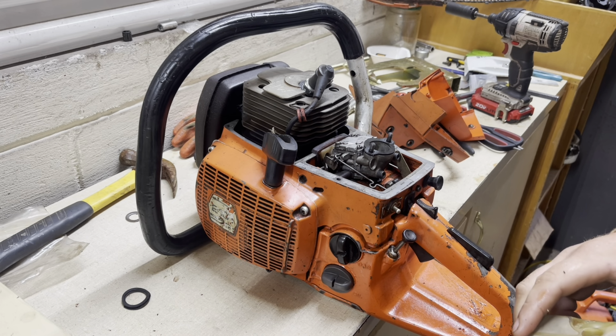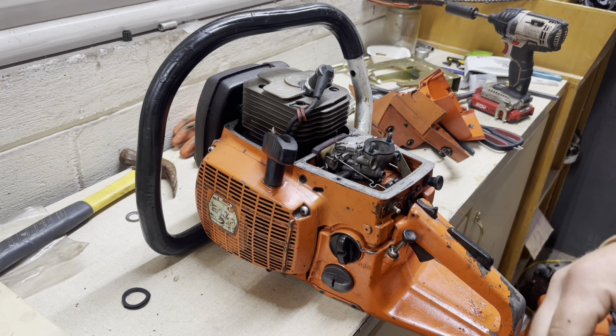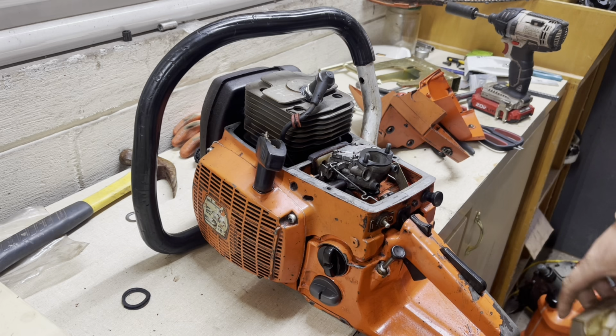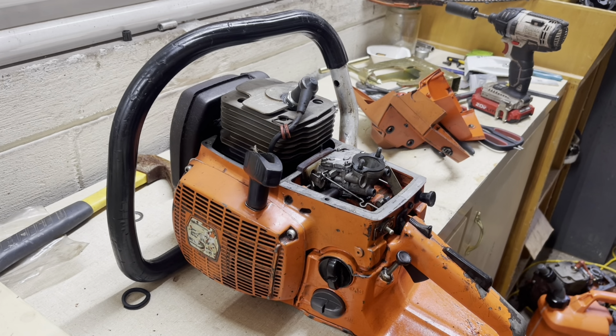And it'll probably run with some more modern saws by the time we're all done. It should outrun them. Not saying it'll outrun everything, but it should run pretty fair. Never done one of these before, but the ports in these are very similar to any 2 series Husky that's closed port. So like a 272, for instance, or a 288, the port design on these is very similar.